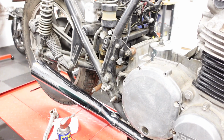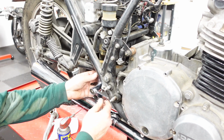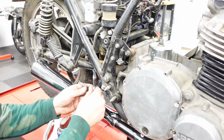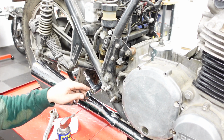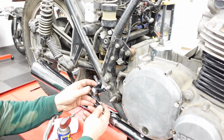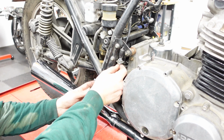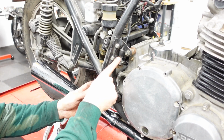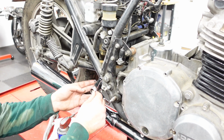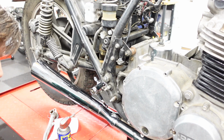This thingamajig has to go on this pivot and actuate the brake. Probably like that. No. Why are there two things? Okay, there's two things because one is a spring that goes to this switch, which is the rear brake switch, I'm gonna guess. And the thing back here is what goes to the push rod that pushes in the master cylinder.